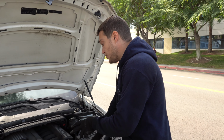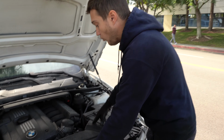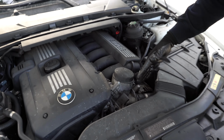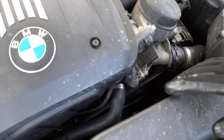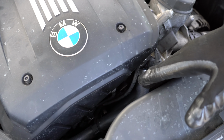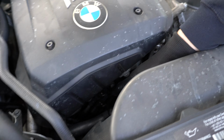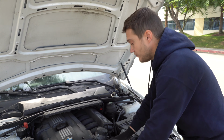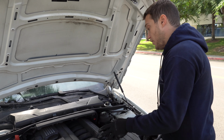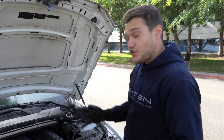The next damaging point, that would be the oil from the oil filter housing gasket leaks down this way, down the engine, and on the way out there are the Vanos solenoids, those two right there. And when you damage those, all hell can break loose. Those solenoids control the Vanos, and the car can act really strange, so it's best to avoid that. So let's get to it.